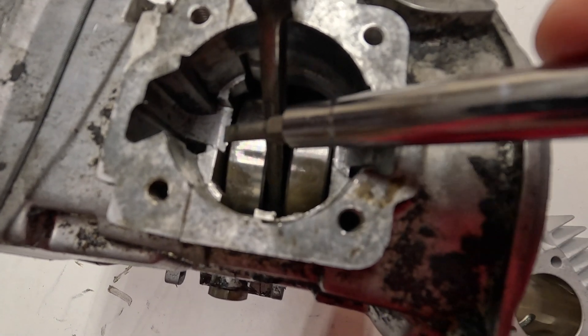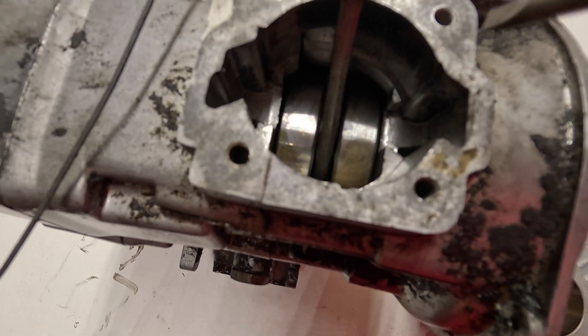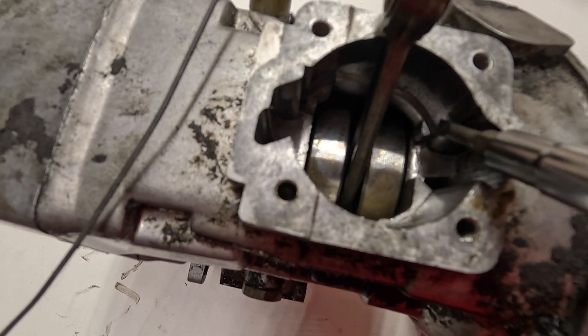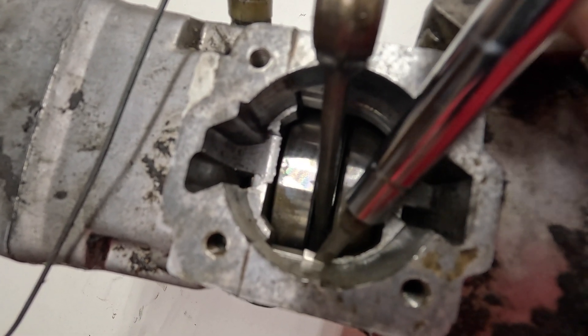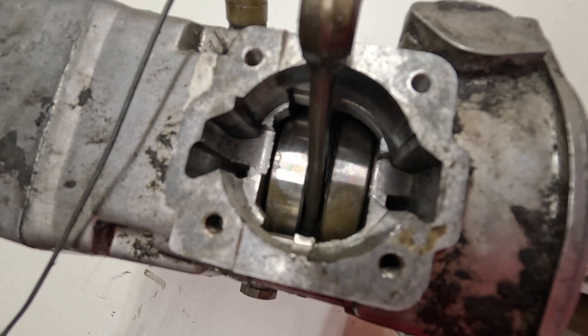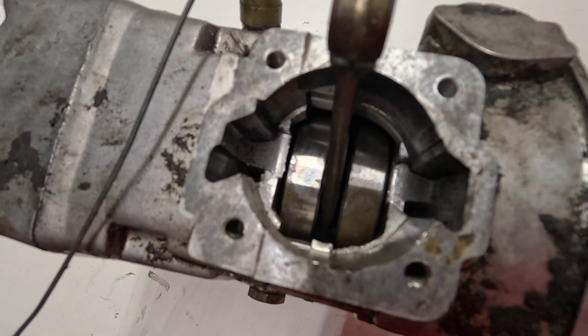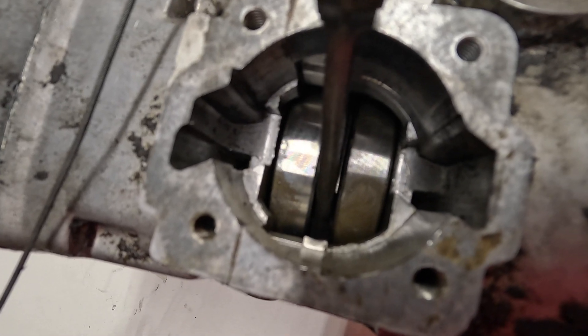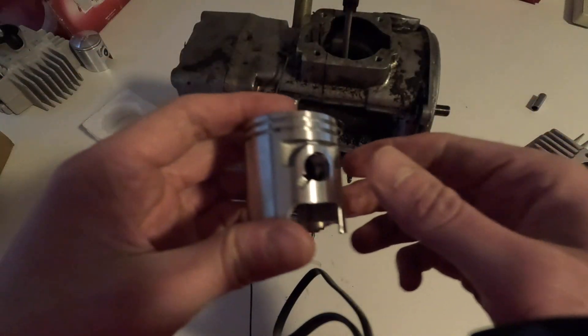Here I'm just going to show you some of the other points that it might possibly hit on. If it's hitting one of these points, you'll just have to grind the piston down ever so slightly. But this main point on the bottom is what it will usually hit, and you can just knock that out. It will break off so easily — just make sure you have something to catch it so it doesn't break off inside your engine, if your engine's all together like this one.